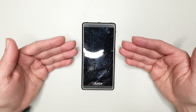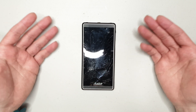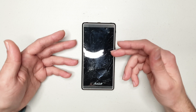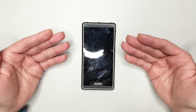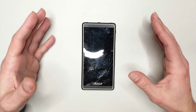You might say, why don't you just plug the phone into the computer and download your information? Well, it's not going to work, because when you plug it to your computer it enters USB charging mode only. You have to swipe down and then choose mass storage device, which you cannot do because your touchscreen doesn't function.